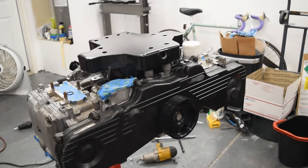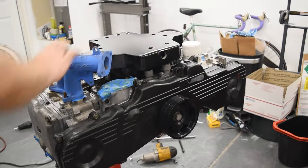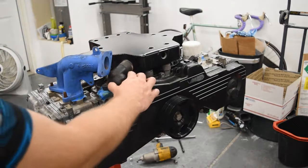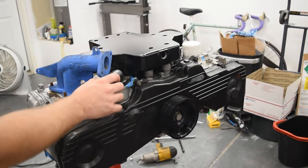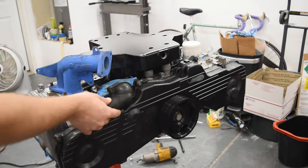in the actual car. Unfortunately, what I did find out is that we're going to have to switch to a turbo water pump. My water pump is here, and as you can see, there is no way we're going to be able to fit the outlet, which is fine. But that means we're going to have to go back a little bit to take the timing belt off. Not a huge deal. I probably won't show you it because we've gone through it. But essentially, a turbo water pump will put the outlet right here so there'll be no issue for the exhaust coming through.